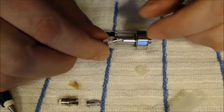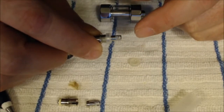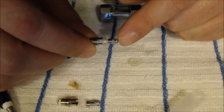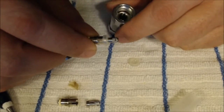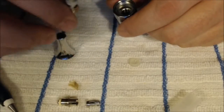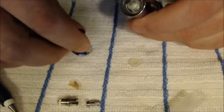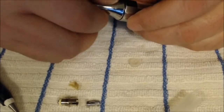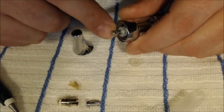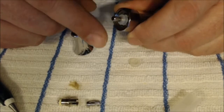Then you have an atomizer head, and I saw people noticing it has these neat little holes. Let me move that so you can see it. The hole isn't in the top there like it is on other stuff. Well, the hole's right there on the side. With this being a top coil, what those holes are there to do is to allow air in. If you had a hole in the top right there, you could get spitting. And with as close as your mouth is, because once you screw this in and put your mouthpiece on there, your mouth is right there on top of it, you could end up with hot juice inside your mouth. So they've changed the airflow dynamics of it and put the holes on the side so that if that atomizer does spit, it's not going anywhere. It's not going to hit you in the mouth and burn your mouth, but it still allows the vapor production to happen.